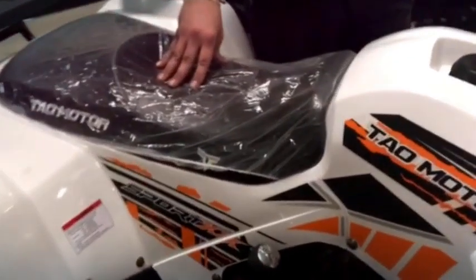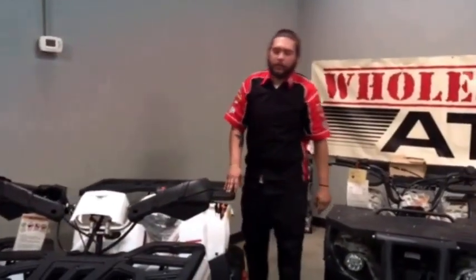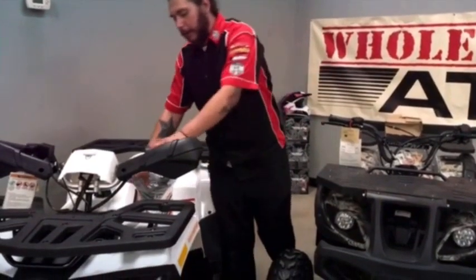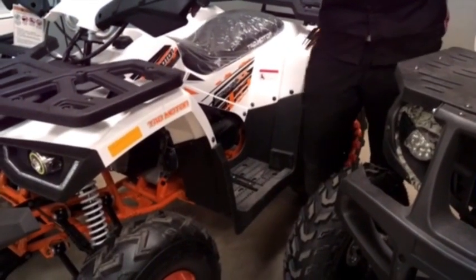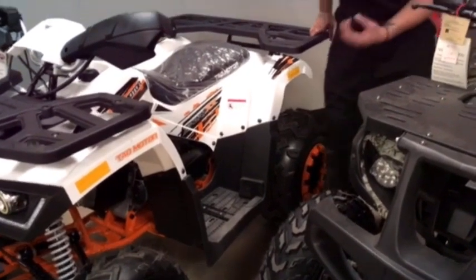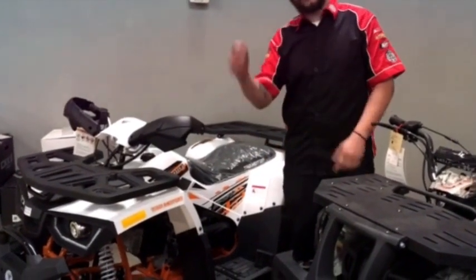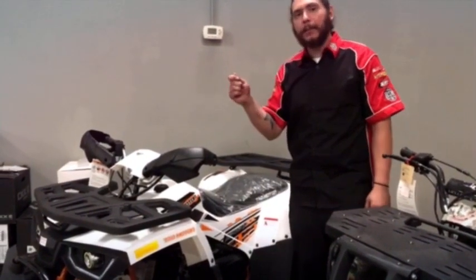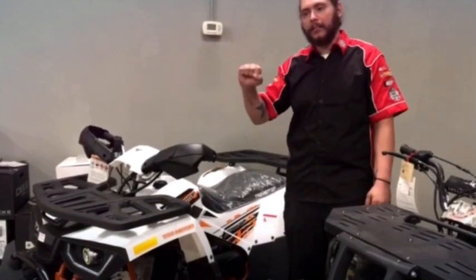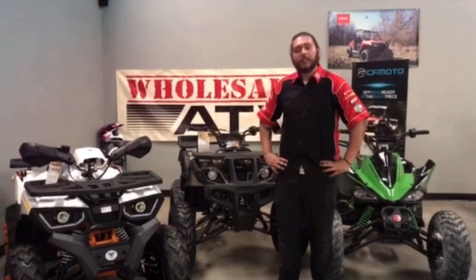If you're low on oil, you're going to want to use 10W-40 ATV oil when refilling. The break-in oil is a thick oil that helps break the motor in, but you'll definitely need 10W-40 ATV four-cycle oil. For the 170cc it only takes about three-quarters of a quart or a little bit more. When you do this oil change, you'll need a 17mm ratchet or socket — the drain bolt is right underneath the case, the biggest bolt you'll see under there. Break that loose and the oil will fall out. Once that steady trickle is done, put the drain plug back in — get it snug but don't hard-tighten it or you'll strip it. Then fill up on the right-hand side.